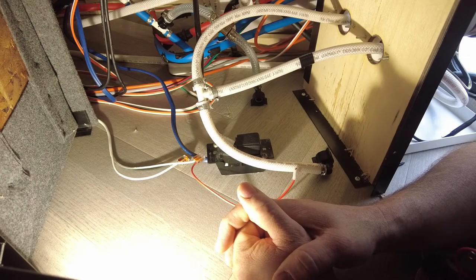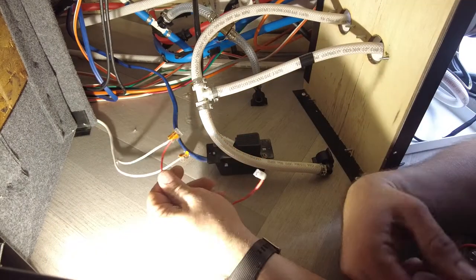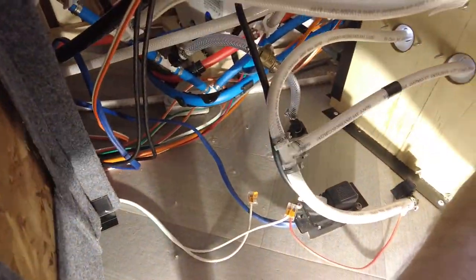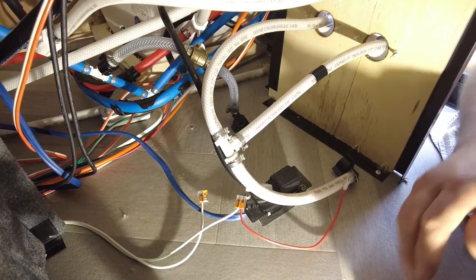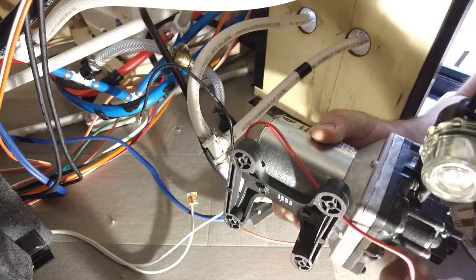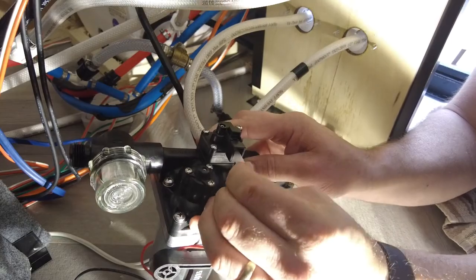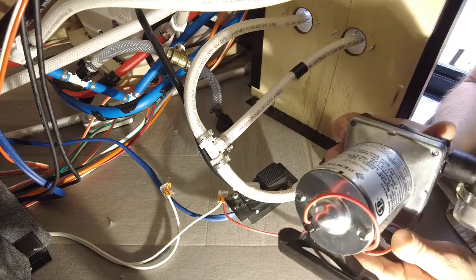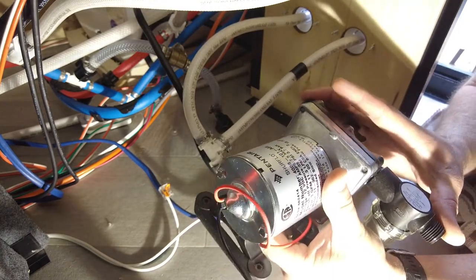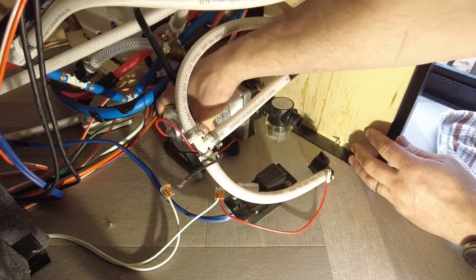All right, we got it cleaned up the best we could. Some of the front-facing wires were moved out of the way and we made a nice little gap for our pump. We separated the wires that go to the pump. The first thing we're going to do is route that red wire back around — it goes to the bottom back tab — and plug that in.